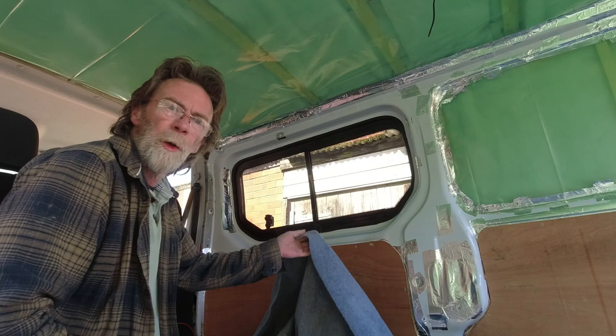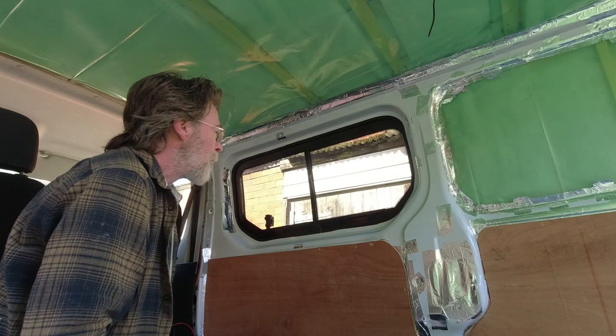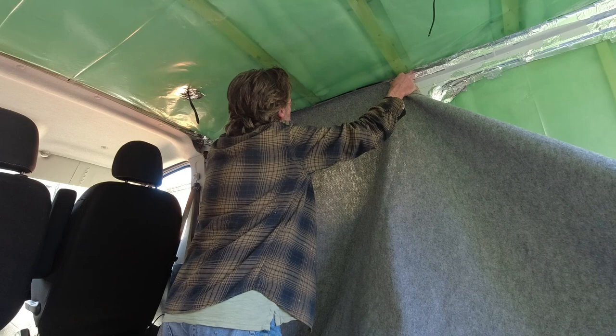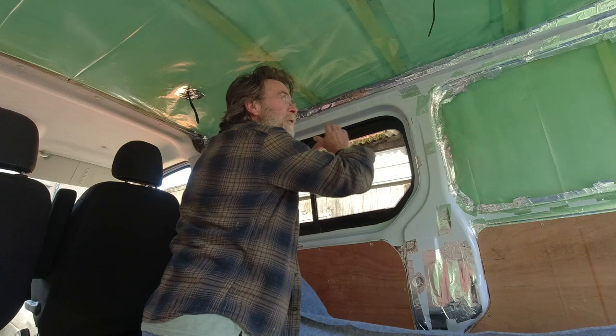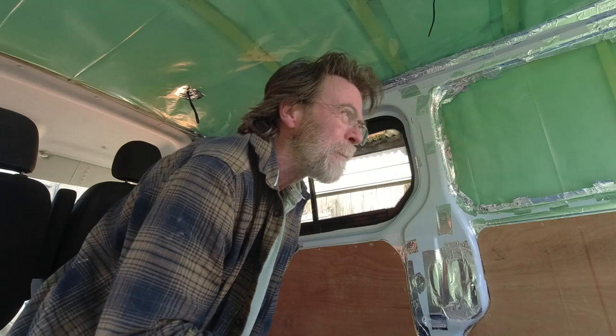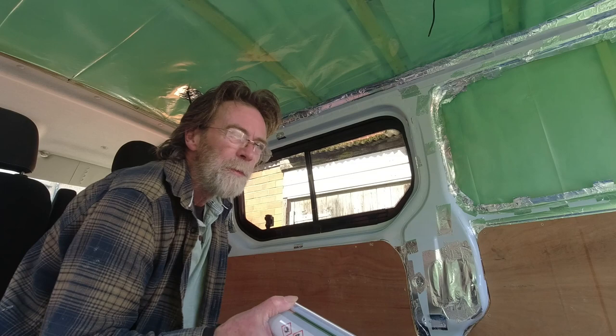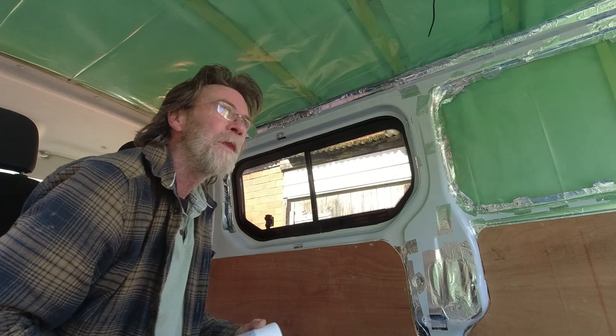This stuff is on a two-meter roll, so that's going to be plenty to get from ceiling to floor. My first thing is just to stick it on this line here. I'll glue just from here down to here and see if I can get the continuous strip on there first. Another piece of advice I got was to not measure the van and then cut it, because as it goes into the contours the length is going to change. So if possible it's best to leave it on the roll until you get to the far end and then trim it - that's what we're going to do.